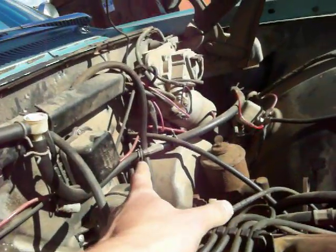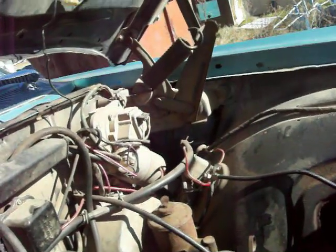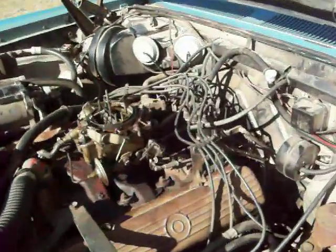Then of course there's the big one that runs over to this check valve and then over to the brake booster. It also tees off way over there into a vacuum canister. The last one coming off here comes from the manifold and runs up to a tee over there.